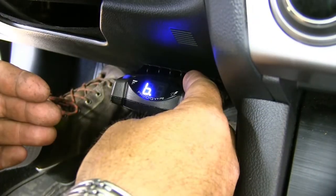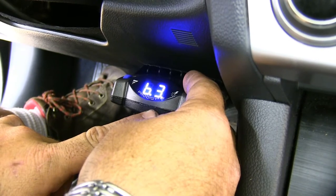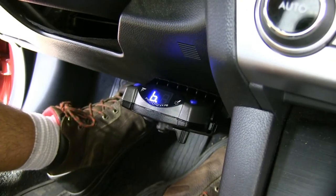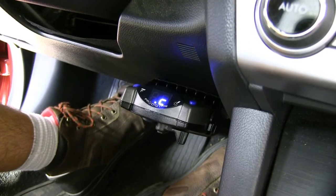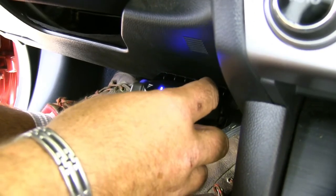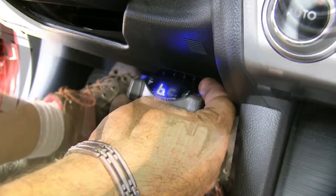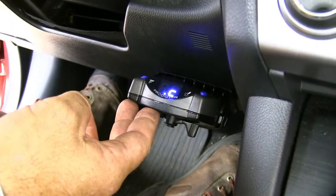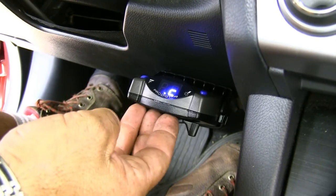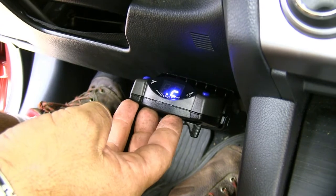The button on the right is the boost button. The heavier the load, you want to go up and boost. When boost is off during braking, the power of the brakes starts at zero and increases with deceleration. As we go up in boost, that will apply our brakes to our trailer more aggressively. This brake controller also provides safeguards — if you're at a long stop, it's going to slowly decrease the amount of pressure on your trailer brakes.